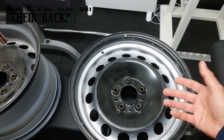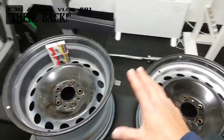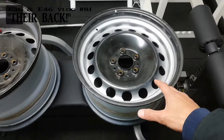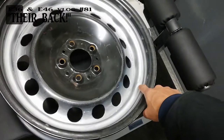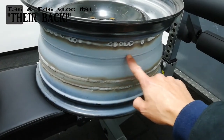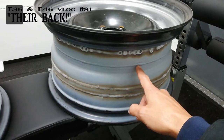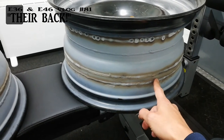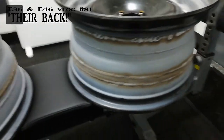You have to put it in the oven, and if you put filler in it or thinner in it, it gets liquid again because of the high temperature. So now I have the option to do a powder coating on those, or to paint them. The gaps are filled up. You cannot really see it but the second weld is like under there. I can see that he didn't weld that one spot, so if you want to do that you have to do it straight away. Anyway, the parts that you can see from the outside but also from the inside of the rim are double welded — that's better to make it airtight and it looks better when it's on the car and you look at it from the outside.